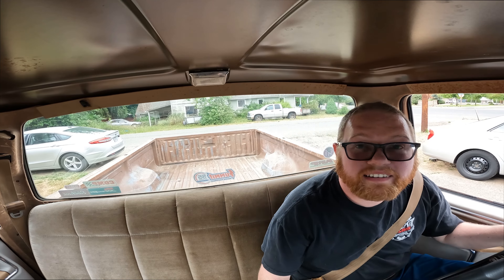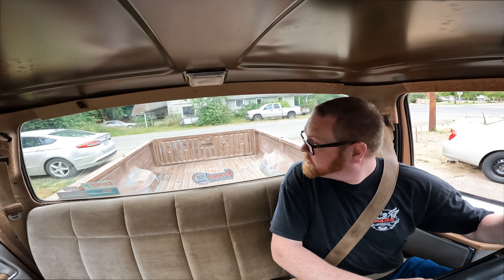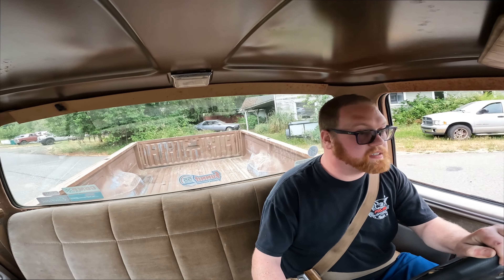I'll permanently tidy up those wires when we're done with the AC relay. I did clean up some of the spaghetti and kind of grouped some things together. Ideally it'd be nice to get a bus bar and put everything on that, but for now that'll have to do. I'm thinking I want to go take this thing for a test drive, put some gasoline in it, maybe mess with the timing a little bit. I fixed the parking brake — working good now, sprayed some liquid wrench in there. The timing was not where it needed to be — I got the idle down to 650 and I got her to 14 degrees.